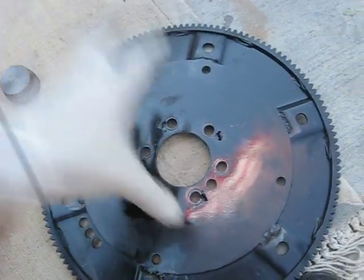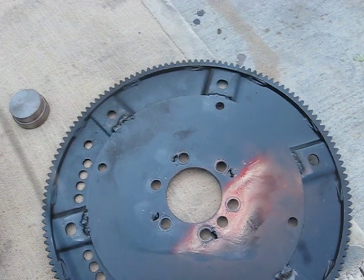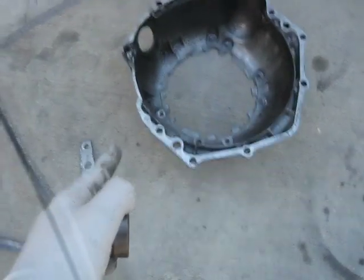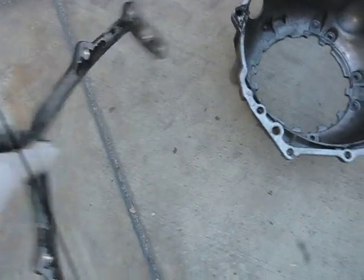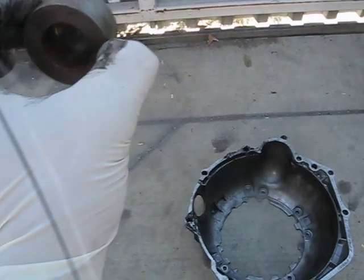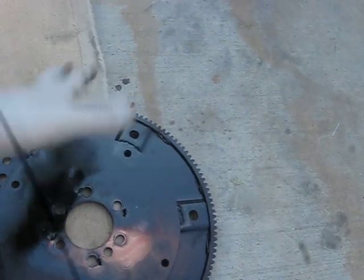So basically you're going to need a 4L60E bell housing — it's a GM transmission bell housing. You might need the optional spacer plate depending on your model; it's basically a copy of the end section of the bell housing — no big deal, you can just measure and cut it from aluminum. You're going to need the crank adapter 100% for sure because this goes inside the crank of the 6.2 diesel and this is where your torque converter goes and becomes balanced. And this round metal piece is part of the original engine — when you take out your transmission you'll find it in there.